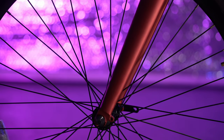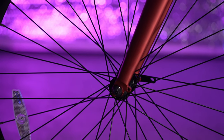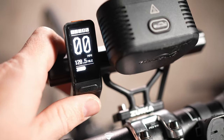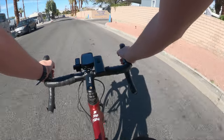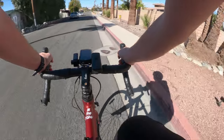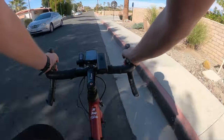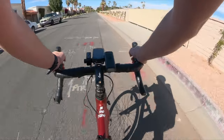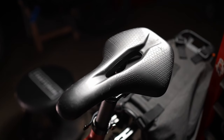The gearing on this single speed bike is somewhat limited, particularly when it comes to tackling uphill climbs. The power assistance is helpful, but even on the maximum level of 5, the motor can still struggle to keep up on a steep incline. I have experienced instances where the motor will just flat cut out and the battery indicator flashes, seemingly indicating that the battery has run out of power. However, after a brief cooling down period, the battery indicator showed that there was a significant amount of power left in the battery. This suggests that the issue was actually due to the system overheating and it needed to take a break, rather than the battery being depleted.